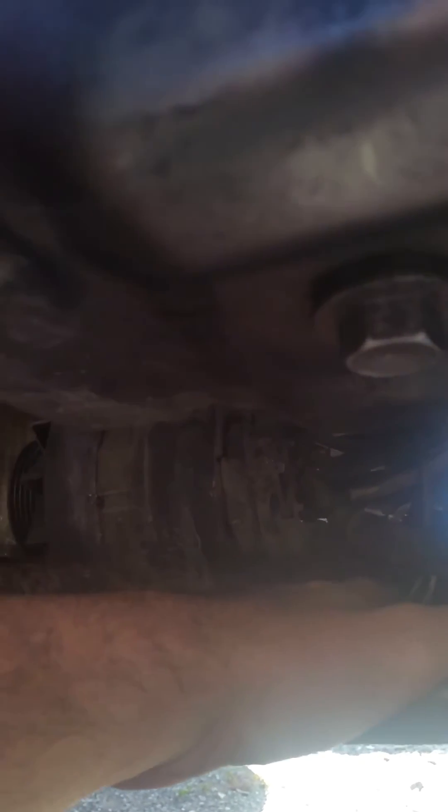You have these two white wires that come out from the bottom of the alternator. One of them hooks back up to the alternator on a screw, which connects to the positive. If you check these wires, they may be loose or broken — mine was broken. So I put a splicing connector on it and spliced it back on.